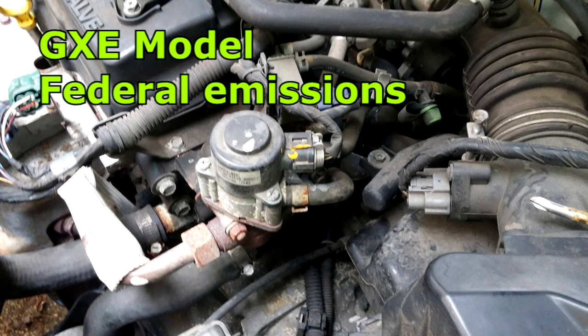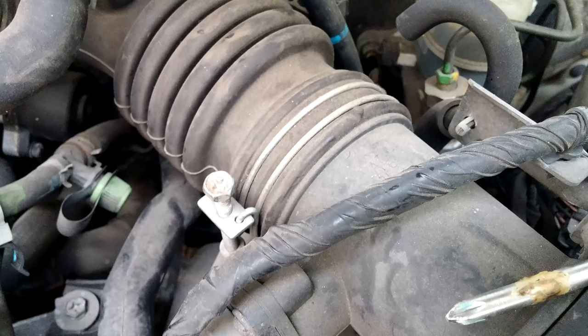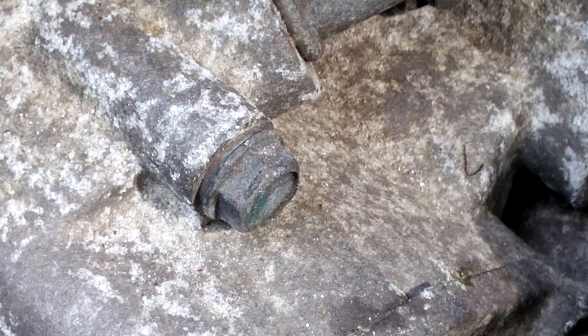Here's a picture of the EGR that's blocking everything. I also had to disconnect the MAF — the mass airflow sensor cable — and there's a tubing on the side. I tried to push the little holders that hold both those cables and the tube out of the way. I ended up just cutting them and putting a wire tie through the hole to fasten the cable, then put it all back together.